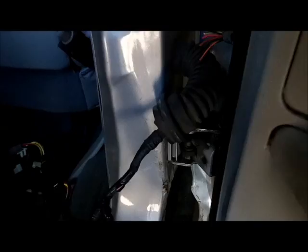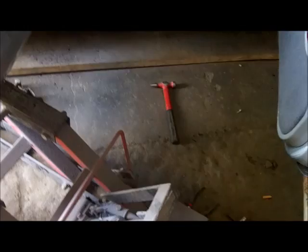Not all vehicles are this easy to do hinge design, believe me. Stick one of our bolts back in here. I'm going to pull the door close, stick the lower one in right now. Then we're going to see how this door actually shuts — if it made a difference or not. It is very common for a door hinge to get damaged in an accident like this. Make sure the wiring is getting out of the way. Let the pressure off the door, and it doesn't look like it really made that much of an improvement.